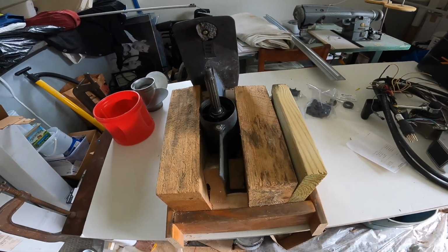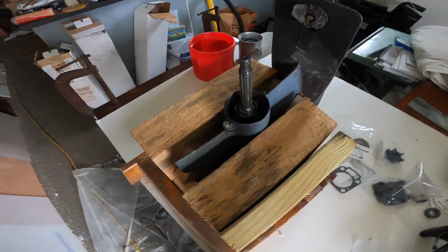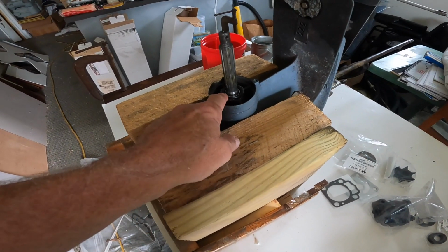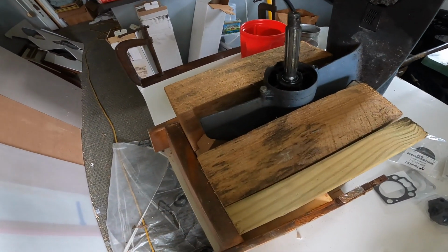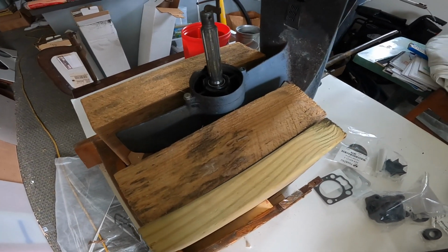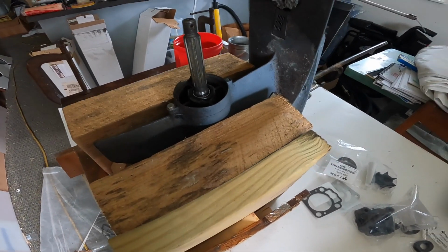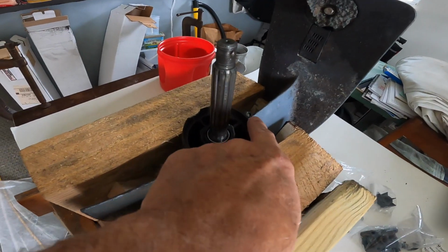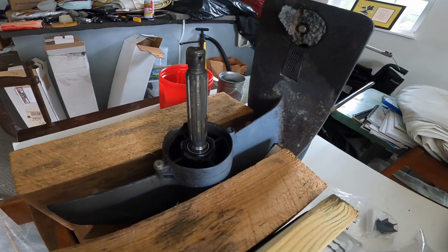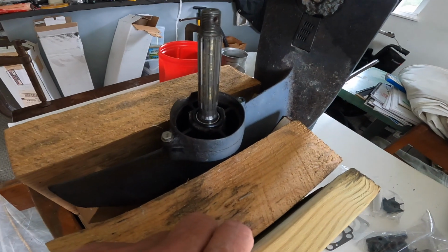This is the lower unit, the foot, off of the Tohatsu 50 horsepower outboard. And I need to change the seal right here where just a touch of the lower unit oil is seeping out just a little bit. I just got this motor a couple weeks ago. I didn't give hardly anything for it. The motor actually runs good. I've got it running decent, and the previous owner had attempted to take this off and broke that bolt right there, and he just decided he didn't want to go any further and just stopped and sold it basically as a junk motor, but it's a good motor. But unfortunately, it's got a couple of problems that we've got to try to address.